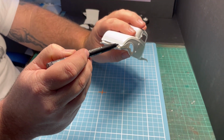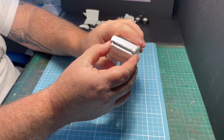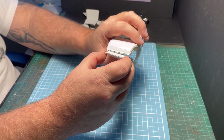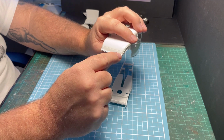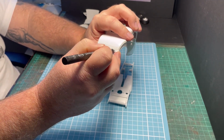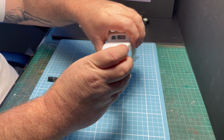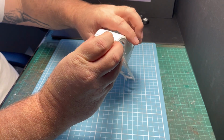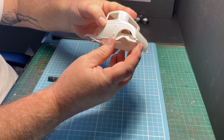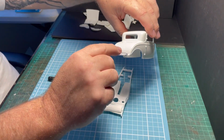you can cut that out of the body if you want, and then get the frame to sit down on the frame, but it ends up coming a fair way. You end up getting rid of this hole. I've just drawn this as a rough example. You'll probably end up cutting right up to here or even further. It's just a matter of trimming and putting on and trimming and putting on just to get it right. So the chassis sits down flush with the body here. That's one way. That's if you want to chop into your body.